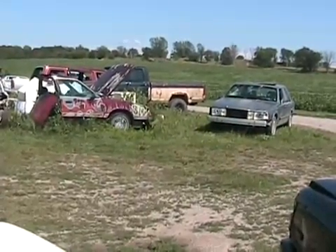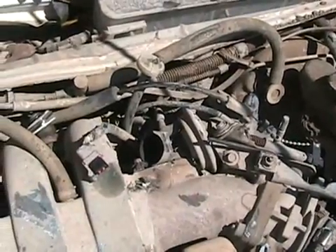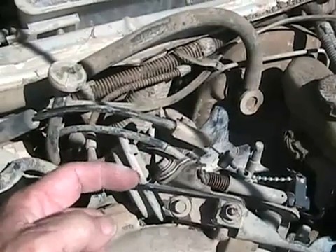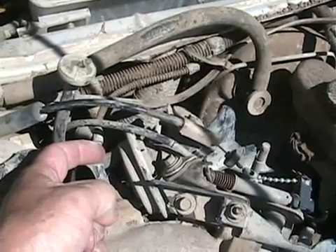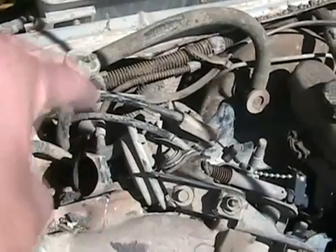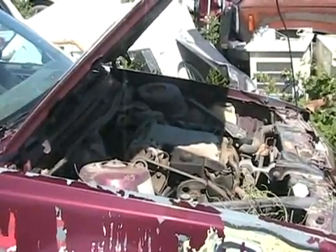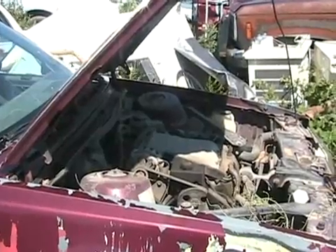This is especially prominent on old Honda Accords from around 1988 to 1992. Things that could go wrong with these valves include diaphragm leaks — easy to test: just hook a vacuum hose to one, stick it in your mouth and suck. If it pulls itself all the way back and stays back when you plug the tube, the diaphragm is good. Another problem is the tube or port the valve sits on being clogged with carbon — just remove the valve and clean it out with wire. Some cars have a problem with the sensor turning the valve on too soon before the motor is warmed up, causing the engine to stall in that in-between stage.